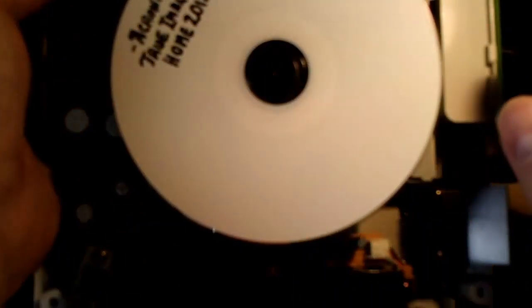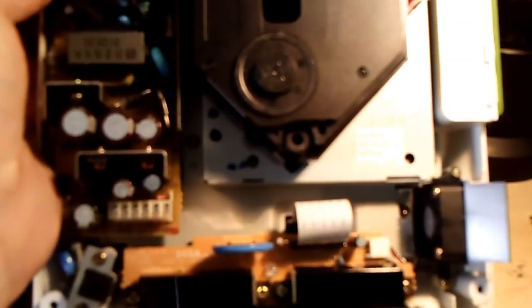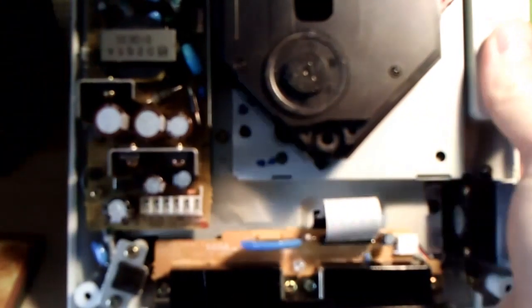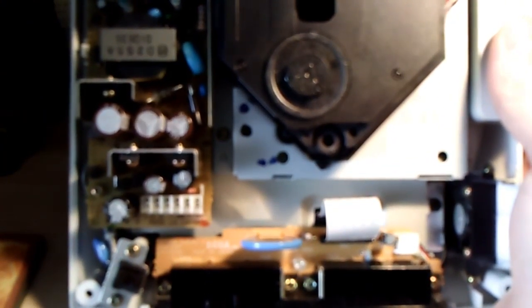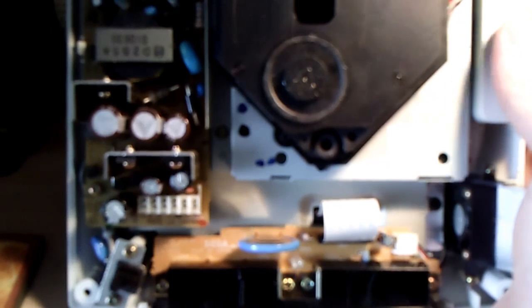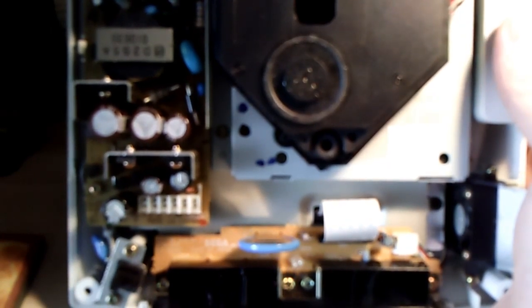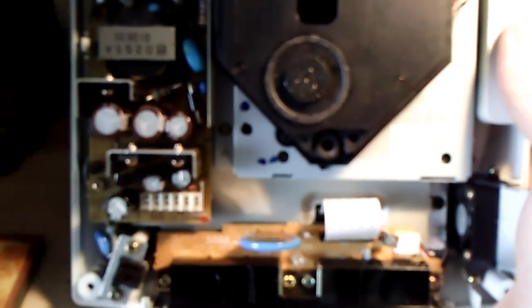But if, however, when you power it on, the disc spins and you hear the usual lovely grinding of the Dreamcast laser trying to read the disc, so you know it's receiving power. You know that it's spinning the disc. And as I said in my video description here, basically if you have one of these eight symptoms: disc spins but game does not load. Disc spins but Dreamcast goes directly to CD player, of course, when you have a game in there.